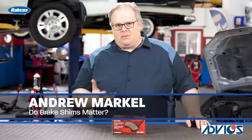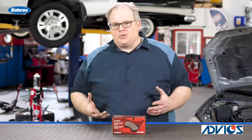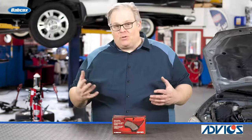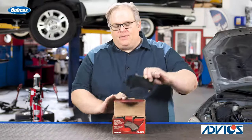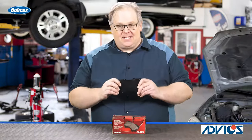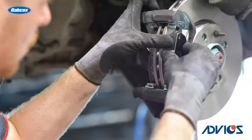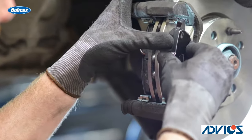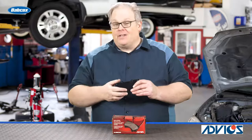So what makes a really quiet brake system? Well, you got to know every single brake system makes noise. It's just how that noise and vibration is transferred to other components — how they control that vibration being transferred into a caliper or a brake pad. It comes down to a shim. If the shim can move freely, then it prevents excitation of the caliper. But if a shim is stuck to a brake pad, it's going to be able to pass that vibration and noise into the caliper, even the strut, to make a different frequency brake noise that you can hear as a human being.